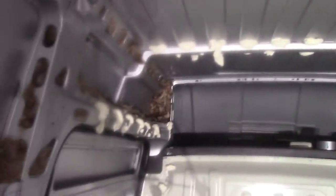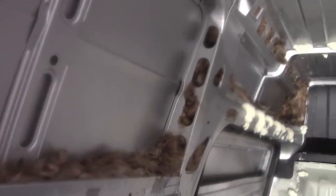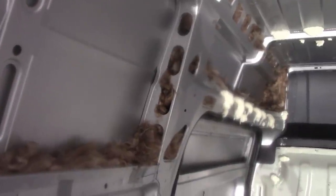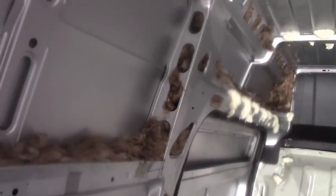Okay, every single accessible cavity has now been stuffed with glass fibre. So all the large frames running around the interior of the van are no longer cavities. They are glass filled spaces, I suppose. Really, we're just trying to stop the flow of air through these cavities, and stop the inner frame radiating warmth to the outer skin and losing heat that way.